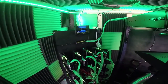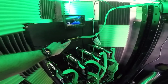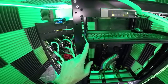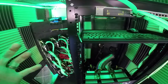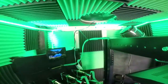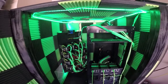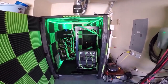You can also see that I've got the watchdog temperature sensor. Looking at the GPU panel, all the heat from the GPUs hits that probe. I've got another probe here which I call the rack — the server rack — which I consider to be ambient temps since it's not in proximity to any of the gear. And then finally I've got one right at the exhaust exit, which I call the vortex, just to get an idea of how hot the air is as it's leaving the enclosure.